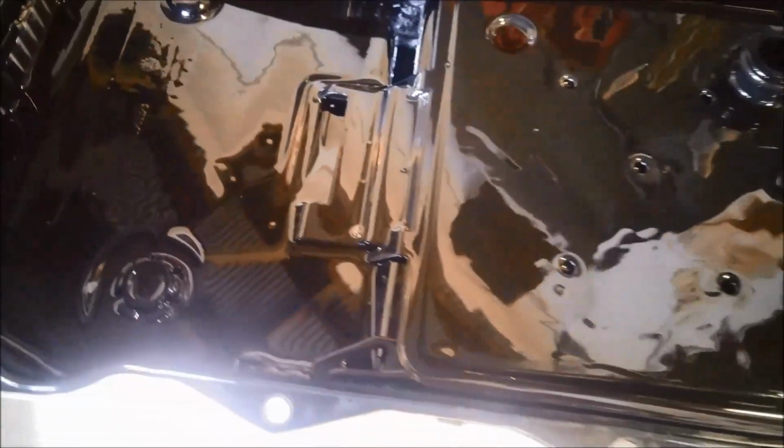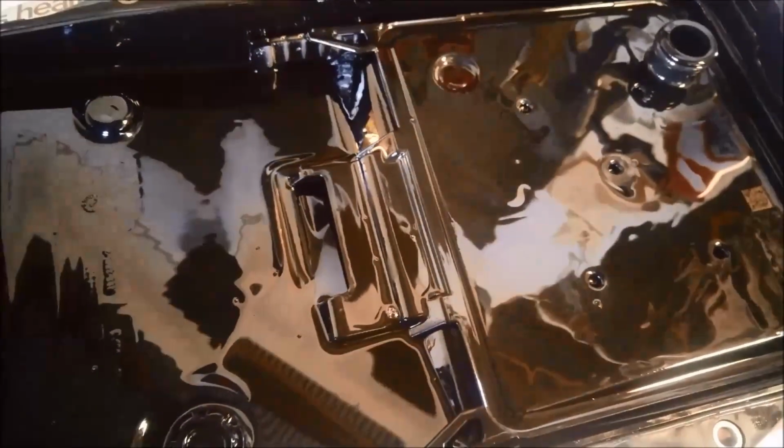At 130,000, good idea to do a service on one of those. It's a good idea to do a comparison there. There's a new one, especially with the little tube that goes into the filter there. I'll take that plastic off. There we go, and just make sure everything looks okay. There's no bits of plastic in there, and make sure the O-ring's there. Always good to have a little peek in there to make sure there's no bits of plastic in the filter. Maybe spin it upside down.